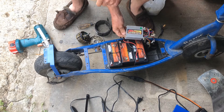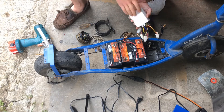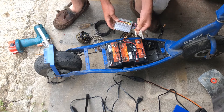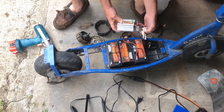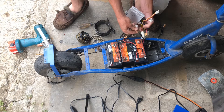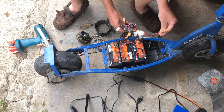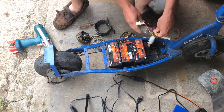We incorporated a 36-volt speed controller — we took the stock 24-volt speed controller out and put in a 36-volt one, which we picked up from Fast Scooters. It was pretty easy to plug in; all the plugs were labeled. There are headlight and taillight connections, which I don't currently have on the scooter. We plugged in the brake, the charging port, the controller for the new throttle, and used XT60 connectors to connect to the battery and to the motor.